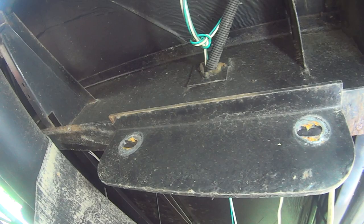The reason the existing receiver hitch cannot be used for double towing is the weak attachment method used to attach the hitch to the frame. Essentially, it is tack welded. Some RV owners with this hitch have had a welding shop beef up this area, but that still does not guarantee how much the hitch can tow.